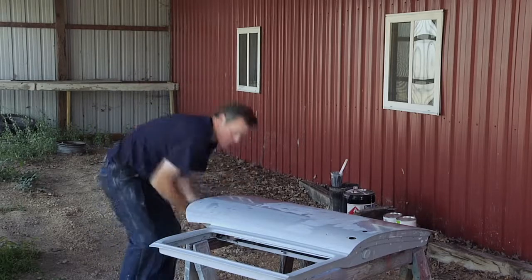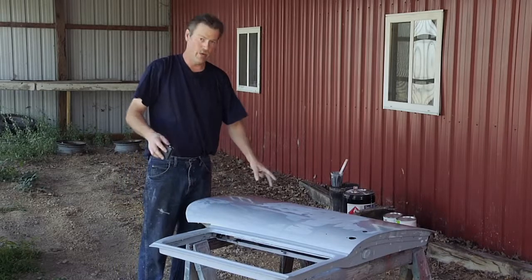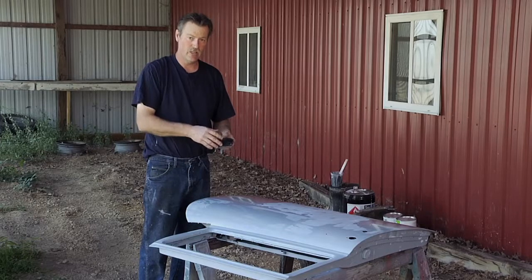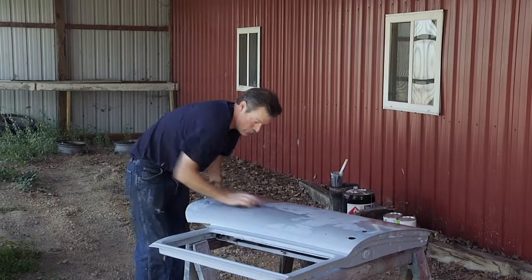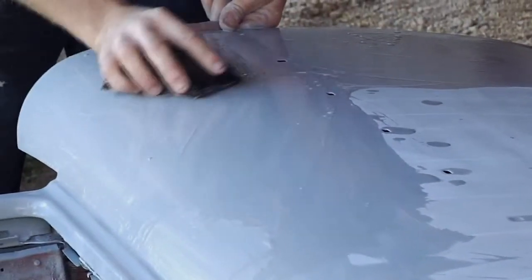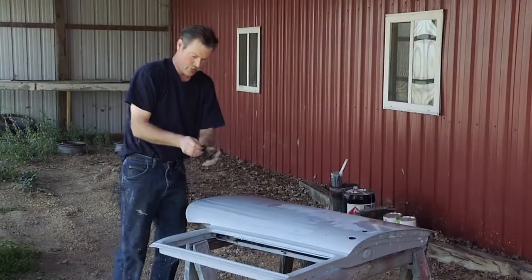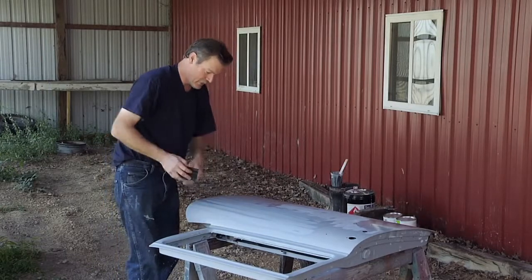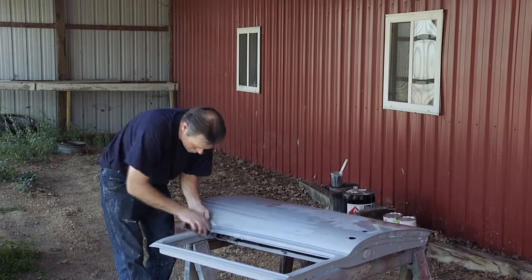It's important that if you do break through anywhere — where you actually sand back to bare metal — you need to put a quick coat of sealer on there. If you don't break through, this is a perfectly good base for the paint. I'm going to switch over to the sponge to get the curved areas, and again what I'm looking for when I squeegee is dark spots that look like sanding marks or imperfections of some sort.